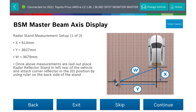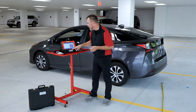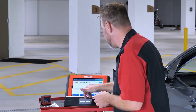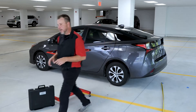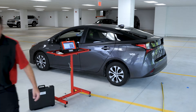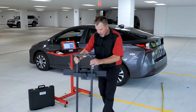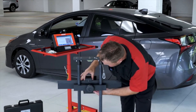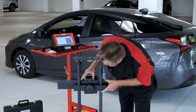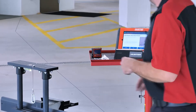My W measurement of 3679 gives me the final location where I'll set up the corner cube. I've got my triangle set up — 3679 was my last measurement, and that's where the corner cube goes. Now, before placing it, there is a zero location on the back of the stand. I slide the corner reflector over to zero and we move on to the next step.